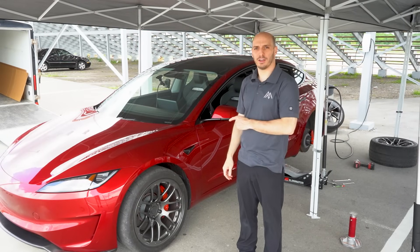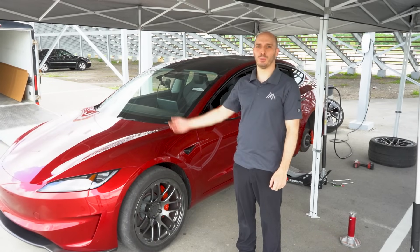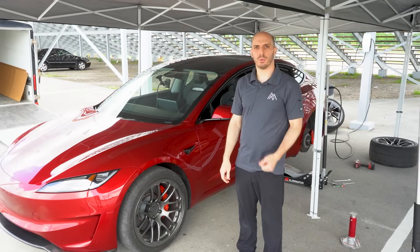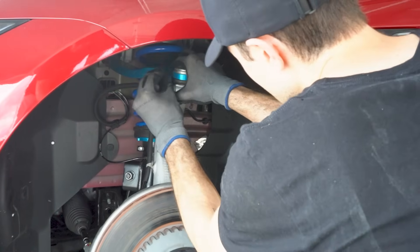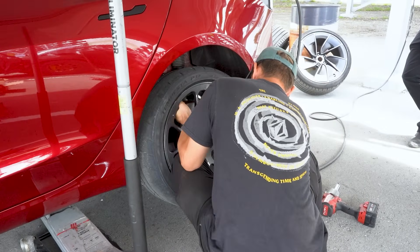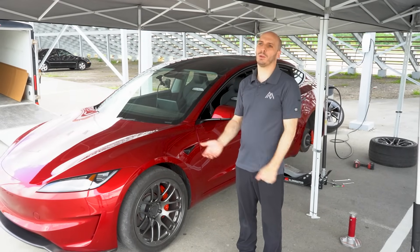We've got a starting track setup on here, just need to fine-tune it a little. We've discovered we brought two sets of rear brake pads, so we've got an Uber driver coming from two hours away. In the meantime, we'll check the balance with our track setup and do a couple laps with the stock brakes. Since the last run we've lowered the car very slightly, taken all the shims out of the front upper control arms for maximum camber, added camber to the rear, and disconnected the rear sway bar to anticipate the extra front grip from the bigger tires and address the excessive oversteer.